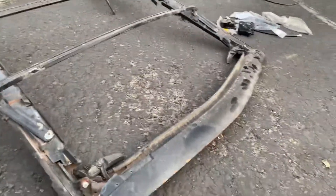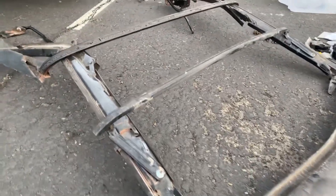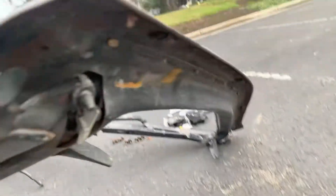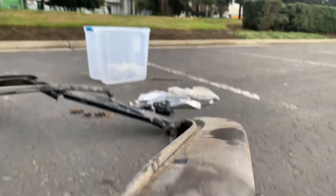Overall looking at it, the finish is actually pretty good. It's an original-looking rack that came out of a 74 Caprice. The second bow right here — see how it has the plastic? That's the aftermarket one; it should look more like this. I was looking underneath and it has a little bit of rust, and maybe one of the tabs is a little rusted off, but that's all right. Overall this is a good original header bow, so we're good there.